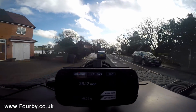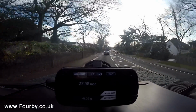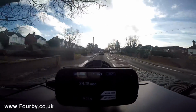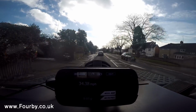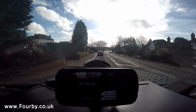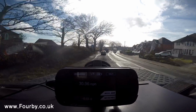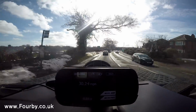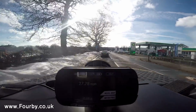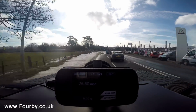The principle is exactly the same. What we're doing is using the car's engine to accelerate a mass, and in turn, using mathematics, if we know how fast it accelerates the mass, what the mass is, the time frame it accelerated it in, and the force of that acceleration, we can work out how much output power the car's got. And like I say, an in-car dyno is very different from a chassis dyno, because there's a lot of external forces that you don't see on a dyno.